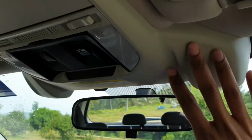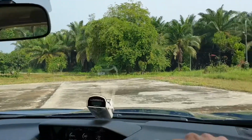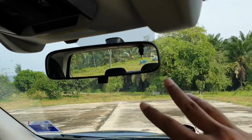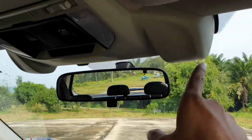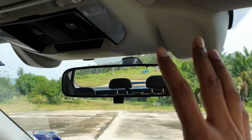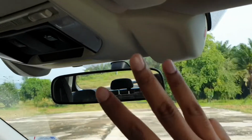So eyesight is one of those technologies that kind of assists the driver to make the car safer, and it can detect cars, bikes, bicycles and pedestrians, but it's very limited because these are just cameras. There's no millimeter wave radar, there's no LiDAR, there's none of those other technologies. It's just stereo cameras and programming. But don't depend on this. This is just an assistant. But there's three aspects to eyesight that you should know about.